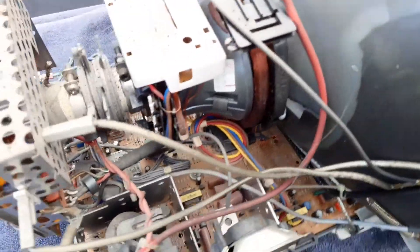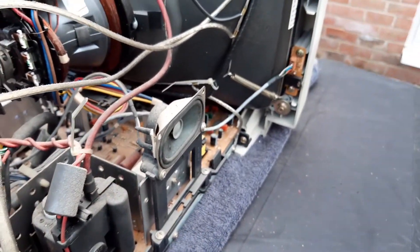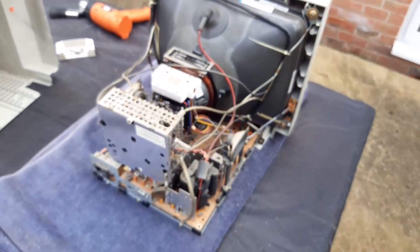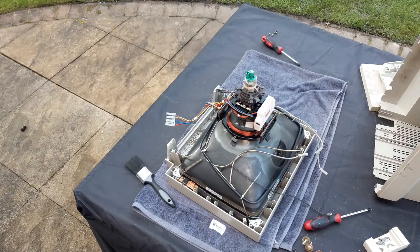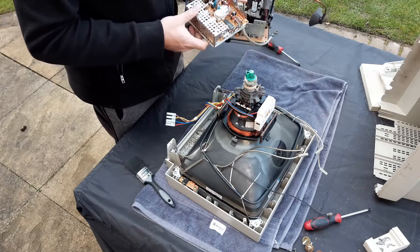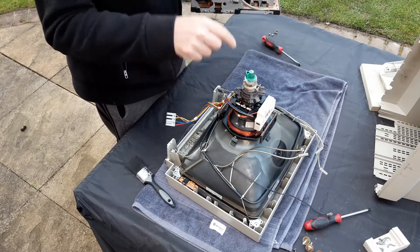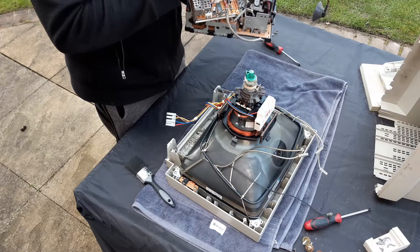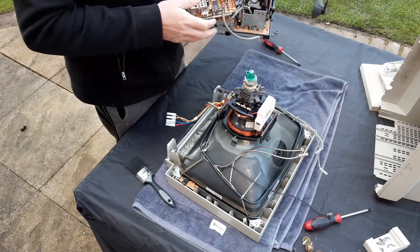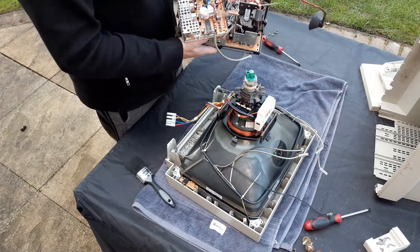This is going to be much more work than it was with the Power Mac, but it's doable — I've done this before with other Mac monitor models. I managed to remove the analog board; it's not easy as you can see. A lot of screws and cables. One thing I need to deal with is that they hot-glued the neck of the tube — this part here — and it was really hard to detach. I had to use the heat gun again to melt the hot glue. Again, if it's not coming off, don't force it — if you break this, you can say goodbye to your monitor.